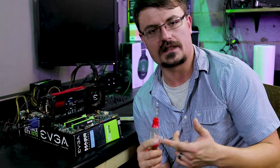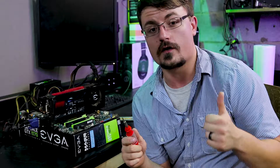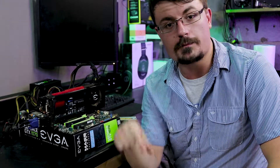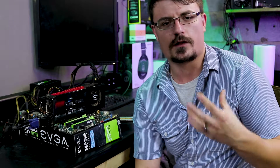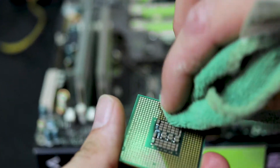The first thing I would check is to make sure your PCI cards and your memory are both inserted and locked in properly — if it's a little off-kilter and not seated correctly, it will cause it not to boot. I would also undo the cooler, pull out the CPU, and just reinsert it. You don't have to push down — it's zero insertion force, so you just place it and then relatch it. Sometimes the elements can cause oxidation on the pins or on the pads of the CPU. Take alcohol with a lint-free cloth and clean that off, then reinsert it and test it.